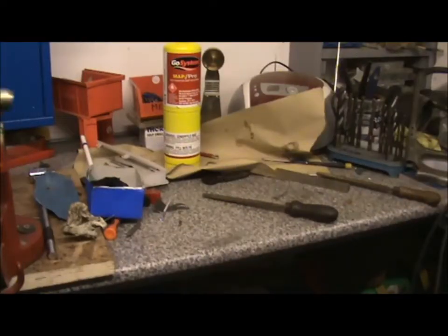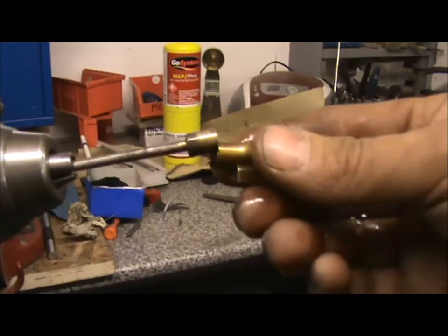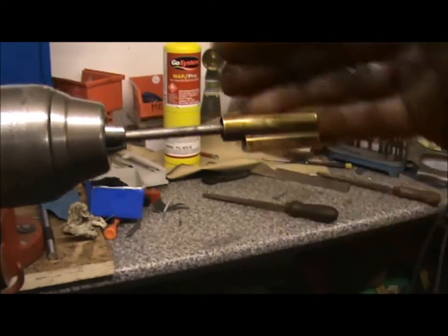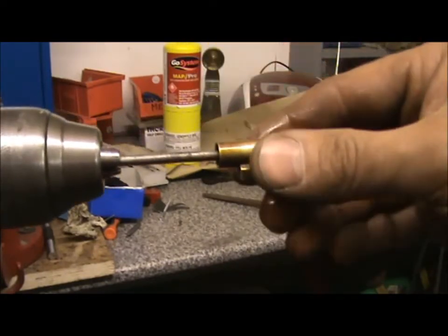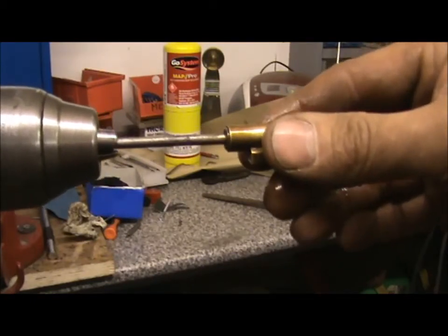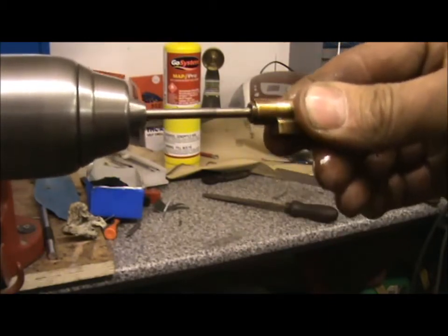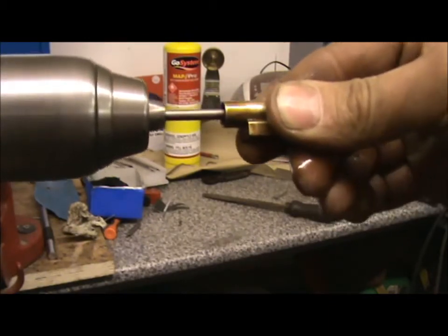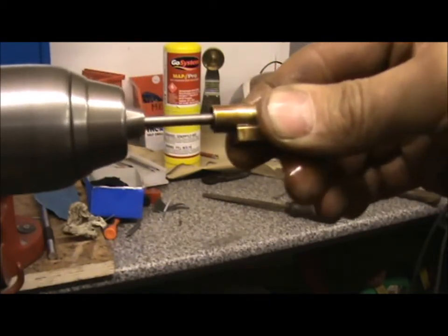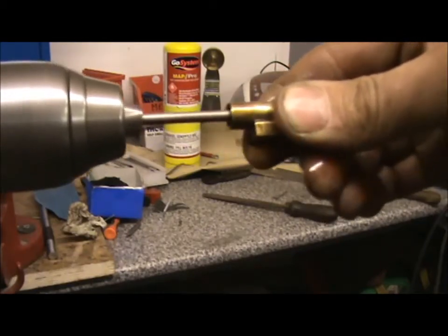Hello and welcome back. Before I show you the engine, I've just got to run this piston in because it's slightly stiff in the bore. By putting a load of oil in there and spinning this around the drill, it acts like it laps it — like you're lapping a valve in an engine. It works quite well. I've just done it on the other piston and it's running really good. I'll do this now for a couple of minutes, and this makes the pistons run like silk.